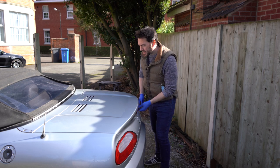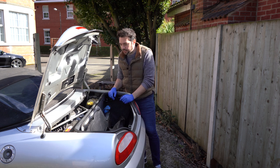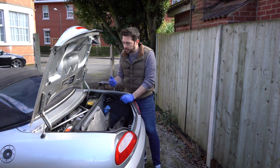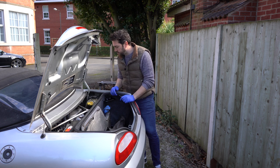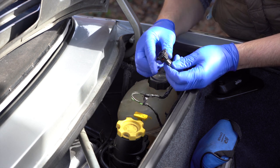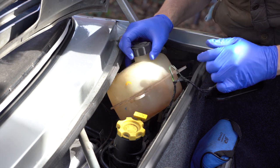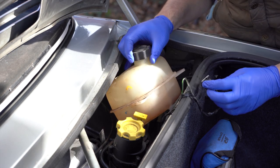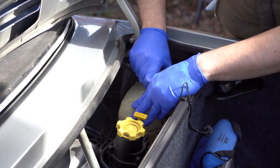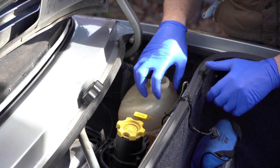One of the other jobs I need to do before I go much further is put some coolant in it - but actually I'm going to put some water in first, because if I've got any leaks it's a waste of coolant. When I start it it's not going to get hot, and by putting water in first and draining it, it might help flush a little bit of residue from working on all the different things. This isn't the original coolant bottle - I lost that in the house fire. I picked this up from a scrapyard but it doesn't accept a coolant level sensor - there's no hole in the bottom for it. So I do need to get another one, but for now it'll do for pouring some water in. I'll cover the actual bleeding of the system in another video when I do the proper coolant.